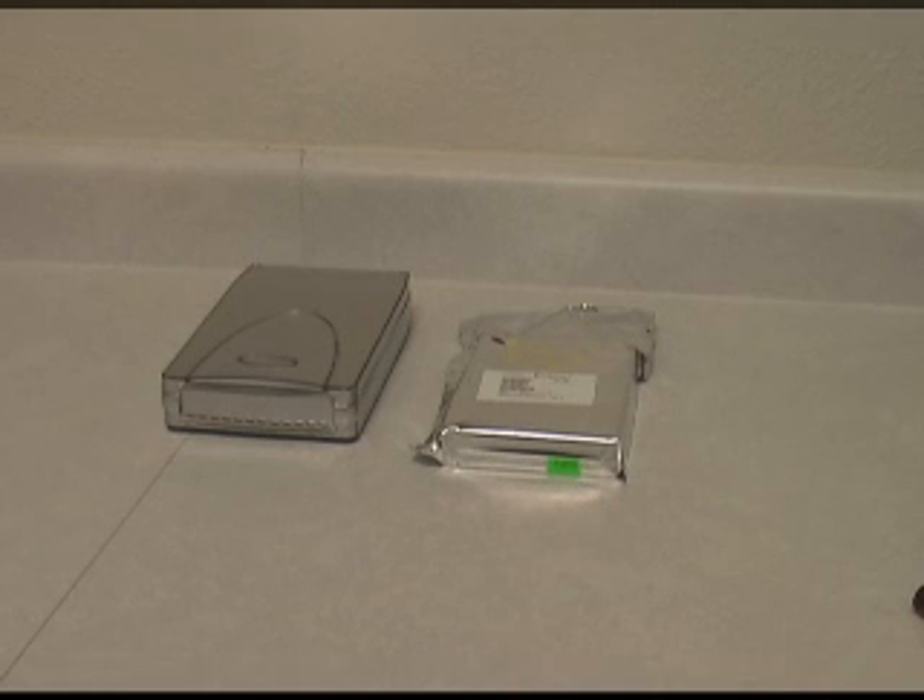You will see that it automatically lets you take care of size differentiation. You can do the new partition the same size, or in my case, just make the whole new drive one large partition. We're going to do it quite easily — we will not even use the Windows operating system. We're just going to boot from the Acronis CD to do that job. Now I'm going to take the old drive out of the enclosure and the new drive out of the bag and put them in a computer.